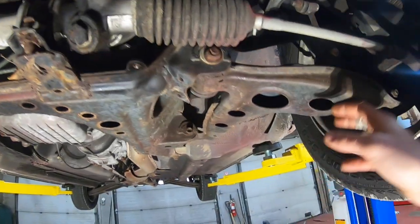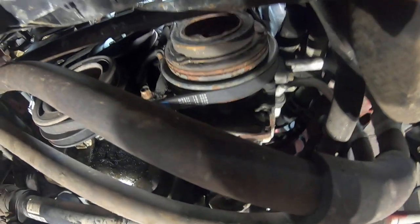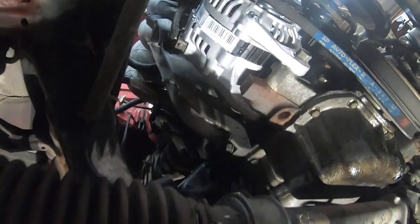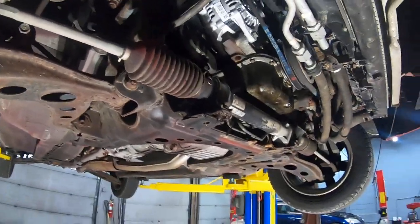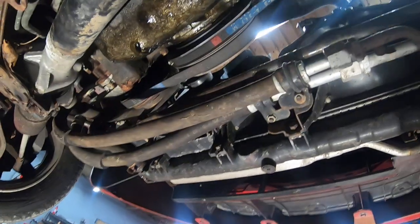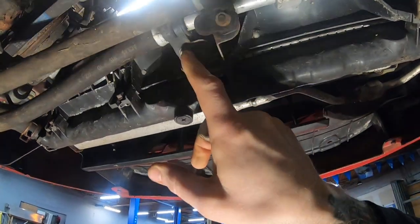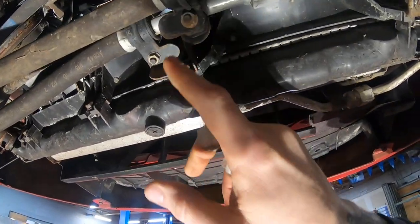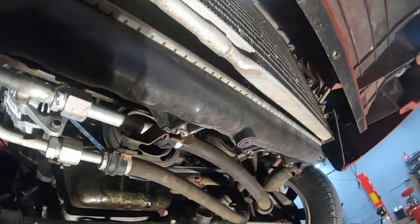You've got your subframe here, lower control arm, upper control arm, tie rod inner and outer, and your steering rack. Your AC compressor is right there, alternator on the passenger side. The oil filter is kind of hidden back here. You can just barely see your starter back there. From the underside you've got your AC lines here — if you're replacing the radiator, easy to forget there are two little bolts holding the AC lines to the radiator. Just take those off and the radiator comes right out. AC condenser is on the front side.